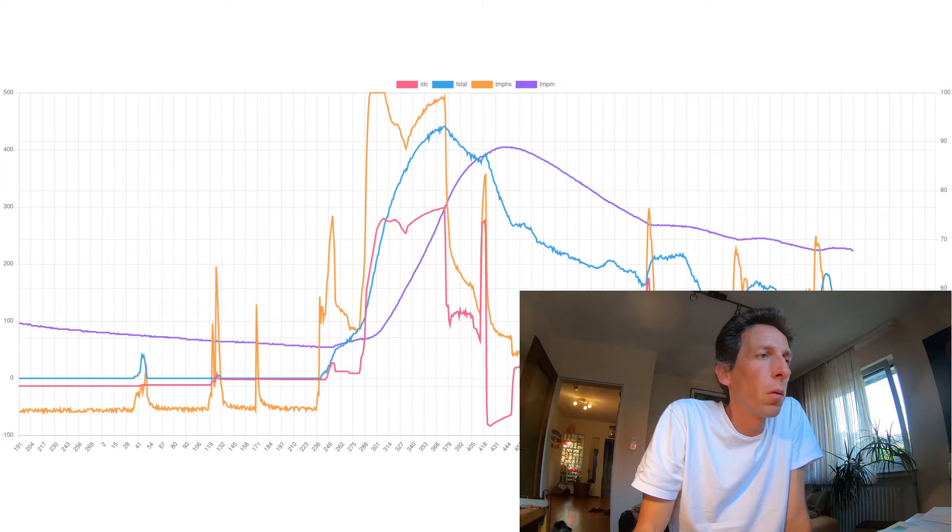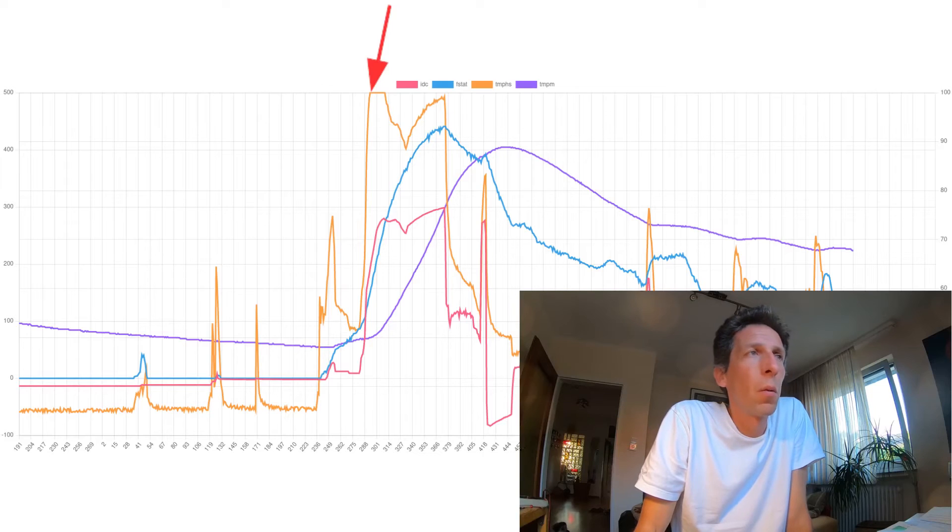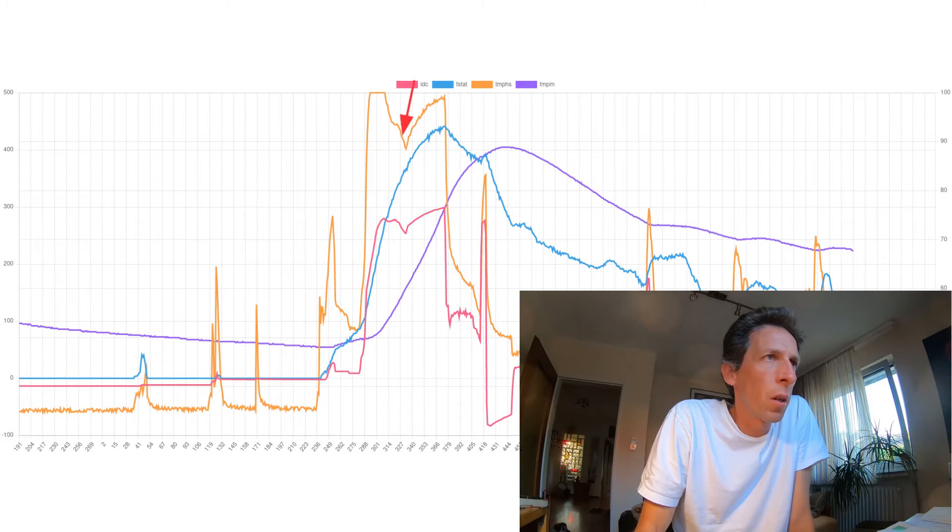The acceleration run starts at around 250, where you can see the frequency rise from standstill to 438. You can see pretty much from where I floored the throttle, the inverter temperature shoots right up to apparently where it saturates at 100 — it doesn't physically saturate, just the reading does. Even when I'm still accelerating, the inverter temperature actually comes down — so that's interesting. The motor temperature is kind of lagging behind a little bit; it slowly rises, and as we reached top speed, motor temperature had reached 76 degrees. Then, even as we are decelerating, it rises further due to that lag and reaches a maximum of 90 degrees.